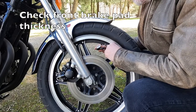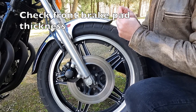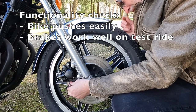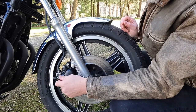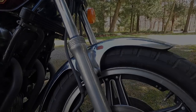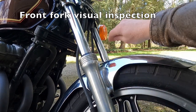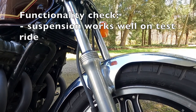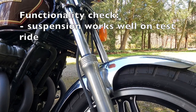We're going to look at the brake pads — these are basically brand new. Looking through, the brake pad thickness is right around 6/32nds for the front brake pads, so those look good. Next, looking at the forks — I'm feeling for any oil residue on either one and there's not. I've run the bike and it runs great; I don't have any suspicions about something being wrong with the front forks.